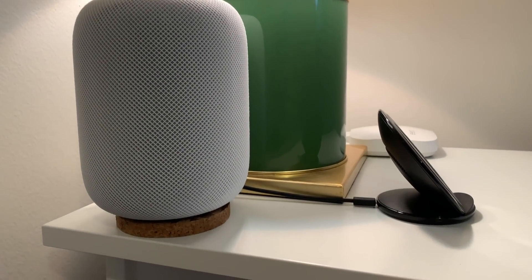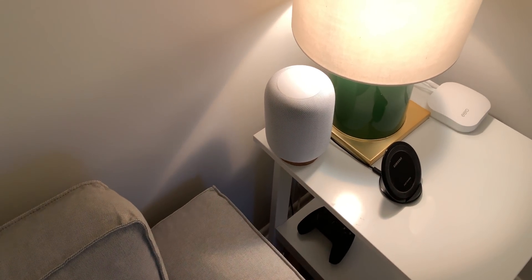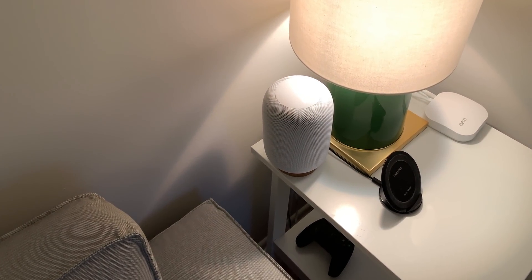The other device you can use is a HomePod. One of the things to consider when picking your HomeKit hub is location in your home. HomeKit doesn't understand how your home is laid out, and ideally you want a hub that's as central as possible — not tucked away in a closet or surrounded by a lot of wireless interference like brick walls, TVs, refrigerators, microwaves, or other wireless devices like a Wi-Fi router. You want it as far away from those things as possible, otherwise you might have issues with your wireless connection.